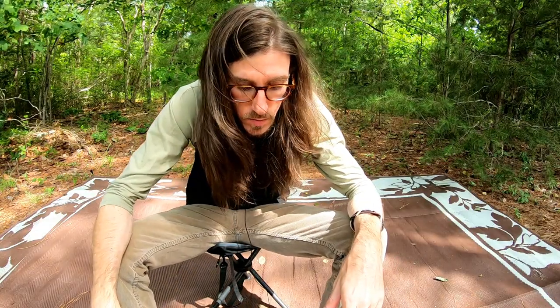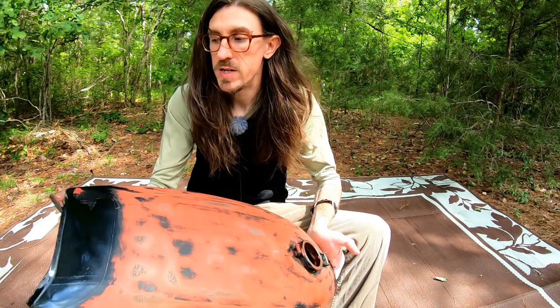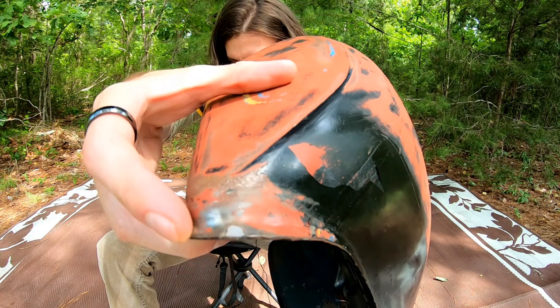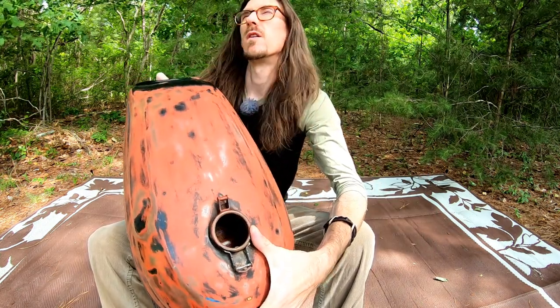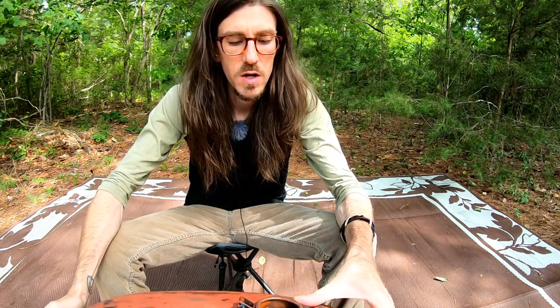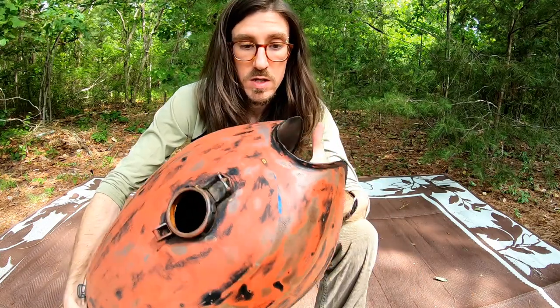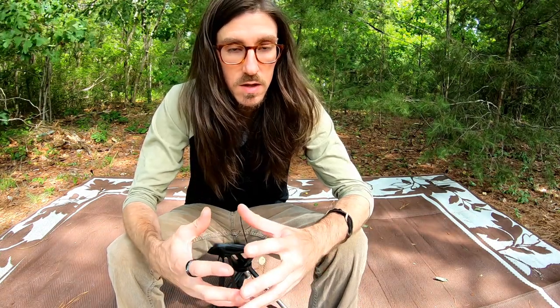I'm back with the tank. My dad put a tack of weld on it — see it, right there. So the next thing I've got to do to the tank is do an acid wash. Muriatic acid. It's got some surface rust, it's not deep. Honestly it's the fastest way — I've tried a few different things and that one works the best out of everything I've tried.